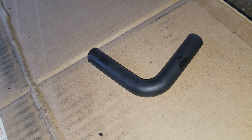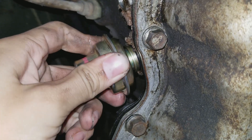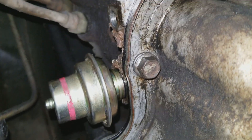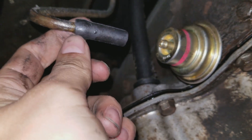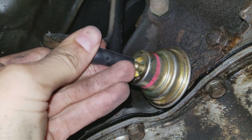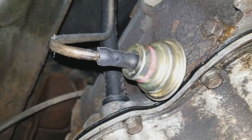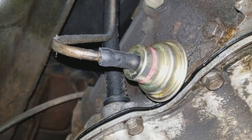After putting a little bit of ATF on the ring, you're just going to slide it back in. The o-ring essentially rests right there on the side of the transmission. Then you're going to reinstall your bracket and bolt. I cut that small piece out, already installed it, and basically just pop this right back on. Your vacuum modulator is fully installed. If this helped you, please rate it, leave a comment, and subscribe. Thanks.